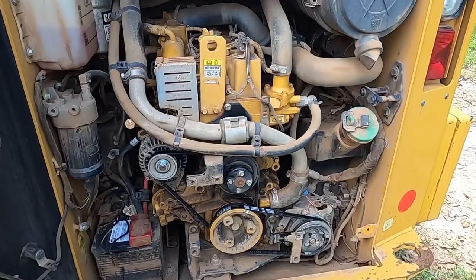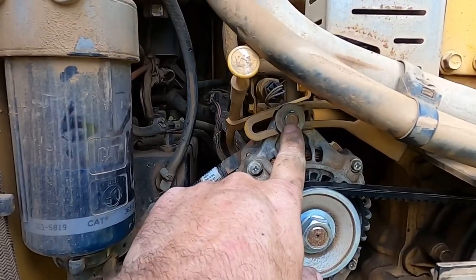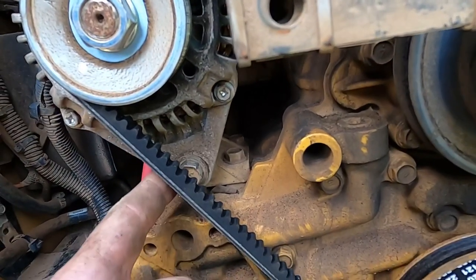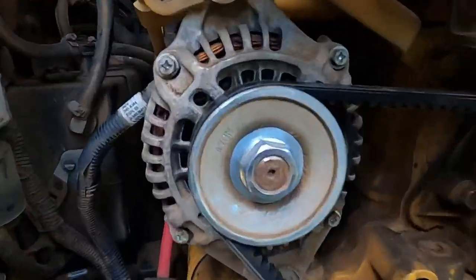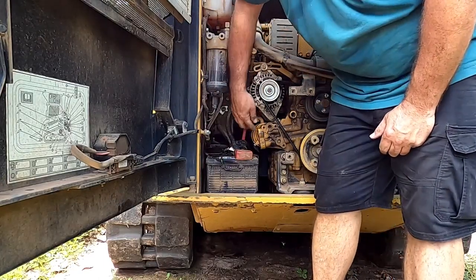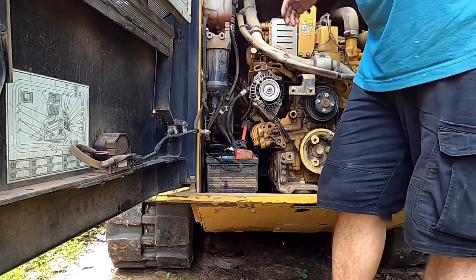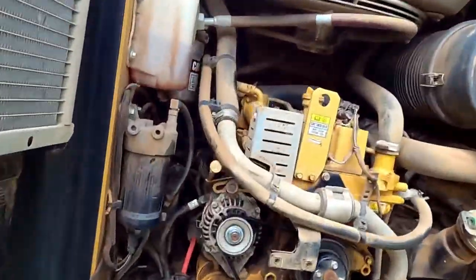I got this all back together. When I did the alternator belt, I loosened this bolt right here but the alternator would not move. The only other bolt holding it was this mounting bolt right here, so I had to loosen that — and it's got a nut on the back instead of just threads. I had to put a wrench on the back side of the alternator and put my ratchet here, reaching my arm down through to hold the wrench and do a push-and-pull to break it loose. Then it had enough slack and moved freely. Putting it back on, I did the opposite to tighten it. It was doable.